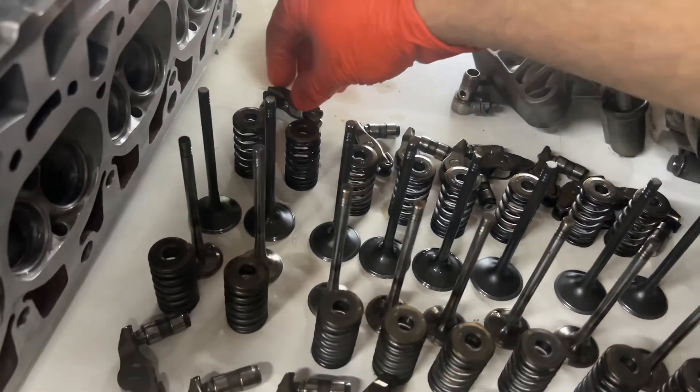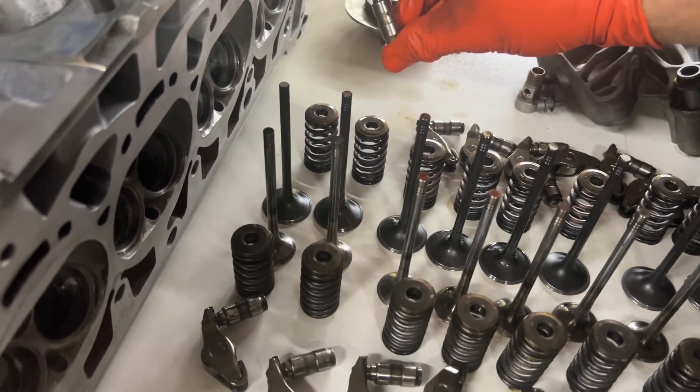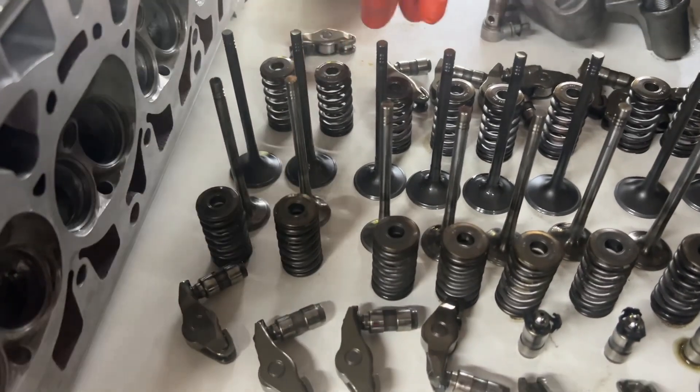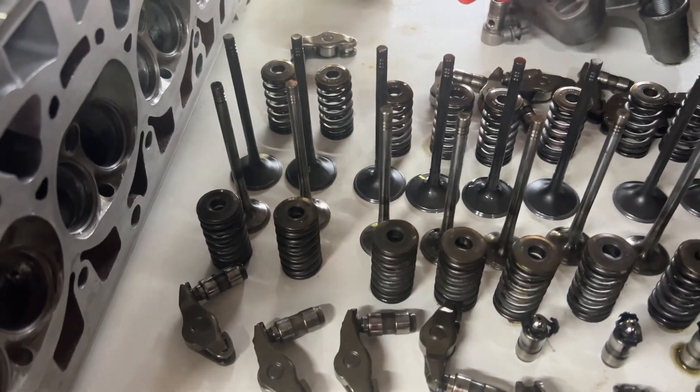When I came to checking some of the lifters I noticed that some of them were completely stiff - this one here is completely stiff, so when I squeeze it I can't feel any movement and no oil comes out - and some of them were squishy.